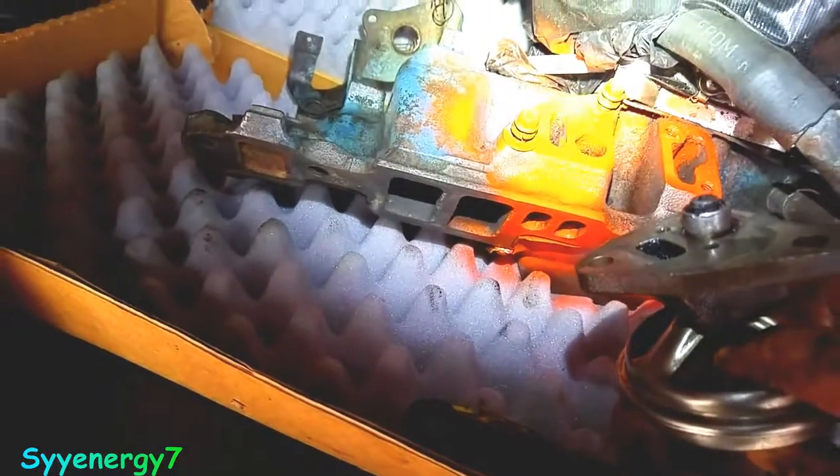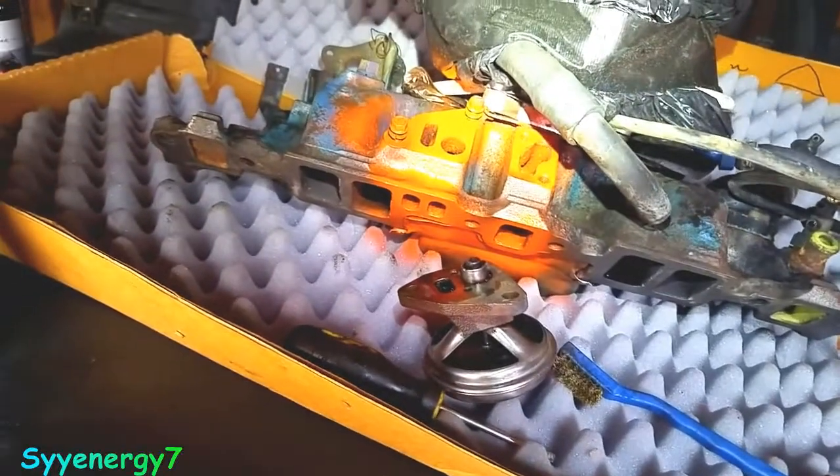What they're going to do, if you go to inspection in California, this is your EGR valve, right? It sits right up on here, two bolts, right there, 1, 2, and there's a gasket. What they'll do is put their fingers underneath here and press in on this valve, like this. See that? The engine's supposed to slow down. You'll see the exhaust opens up here, and then it goes through the EGR valve from one side to the other, and it's supposed to slow the engine down with exhaust gas recirculation, right?